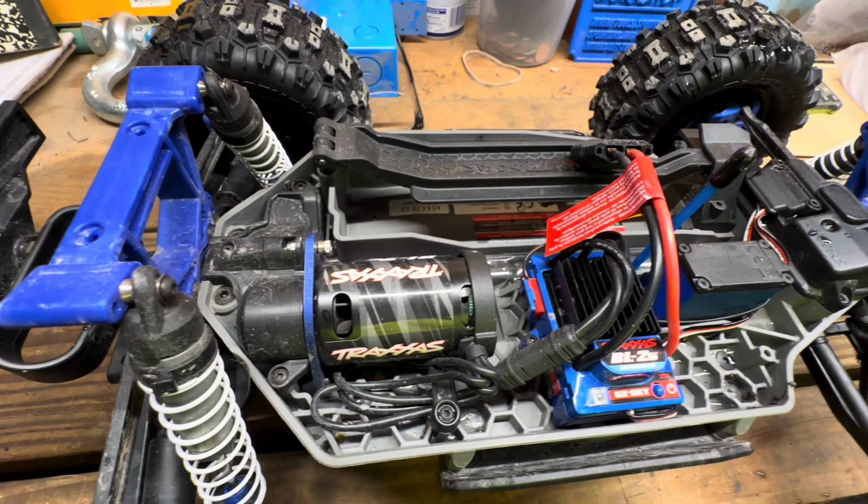I personally have upgraded the pinion to, I think it was a 15 or a 16 tooth pinion, possibly 17, which did up the gearing a little bit, but in turn, it also upped the top speed to about 28, 30 miles an hour. I have not put a GPS on it yet, but I reckon it's right about the 30 mile an hour mark. So, a bit of an upgrade. So, that's that. Speed controller. It's got your training mode.